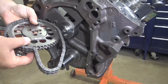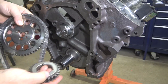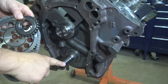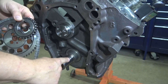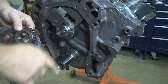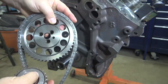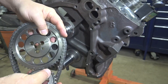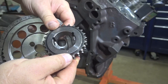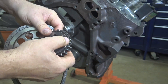Now I'm going to use the same timing chain and gear that I took out, and I want to share this because it can be confusing. It's not easy to tell — the sprocket that goes on the crankshaft has a dot, and that dot goes on the keyway on the crankshaft. The crankshaft is not at 12 o'clock, it's probably at about one o'clock. When you have dot-to-dot or zero timing, the button or pin on the camshaft will be at roughly four o'clock and goes in this hole. You want to set these up so you have dot to dot, but there's another dot on this sprocket right between two teeth — it's really small. If you're doing straight-up timing, the dot here goes to the keyway, and that dot matches up with the dot on the cam sprocket.